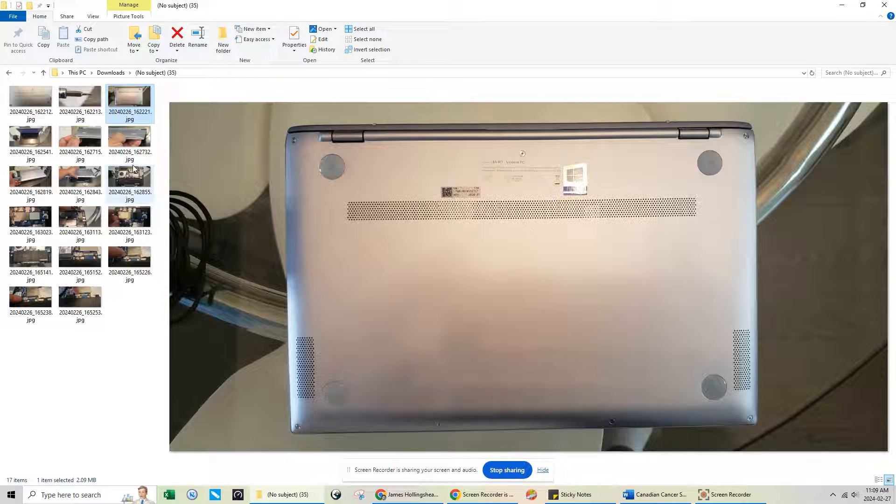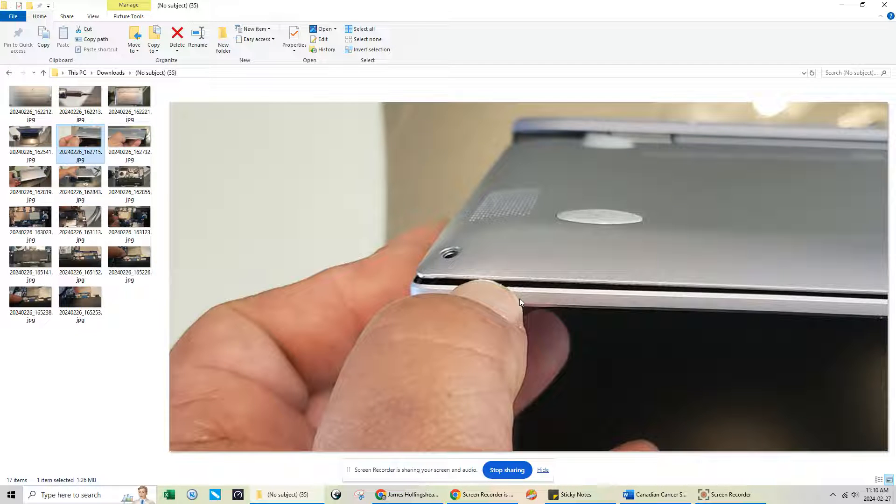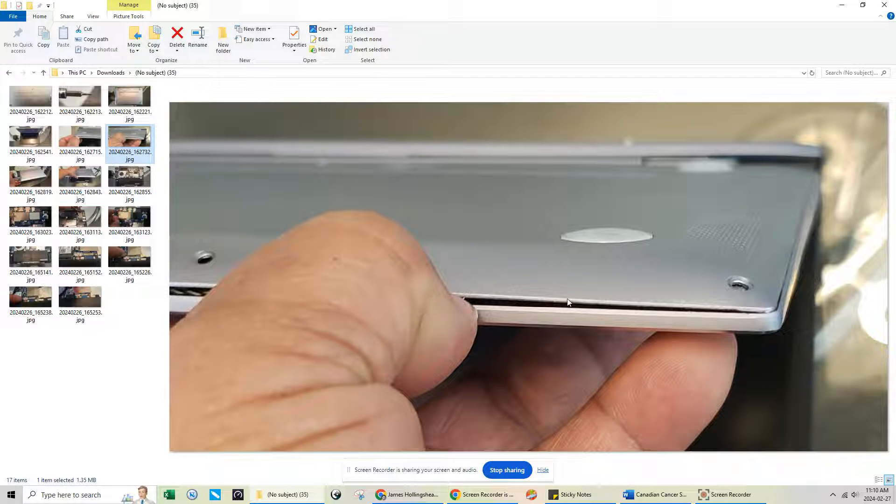Once you remove all the screws, open the laptop back up and keep the screen side facing down, opening the screen to about 80 to 85 degrees as shown in the picture. You don't even need any pry tools because this laptop is built very well. Just use a little fingernail or finger strength. I went to the left-hand corner, braced one hand holding the screen, and literally just popped my fingernail underneath it - it opens up very easily. Then just run your fingernail to the right-hand side and it opens up simply.